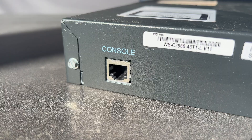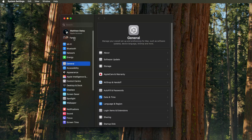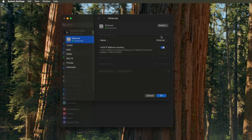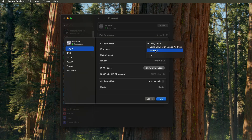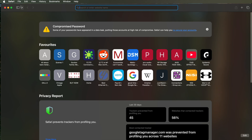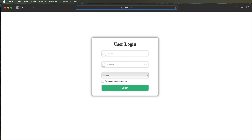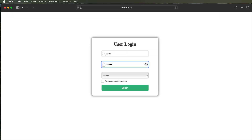Access to the management interface isn't like most Layer 3 switches I've used before — there's no serial interface. Instead, management is done in-band. You just have to set your computer to 192.168.2.something, a number between 2 and 254, then bring up a browser and type in 192.168.2.1, which is the default address for the Binadat. It then prompts you with a login page, and you use the default username and password admin/admin and you're in.